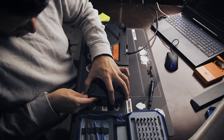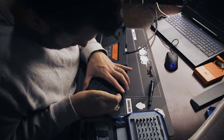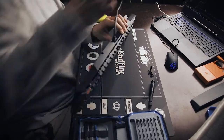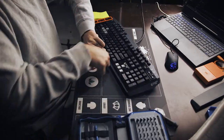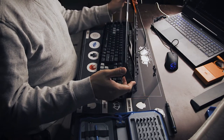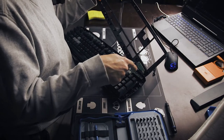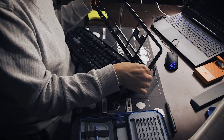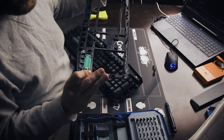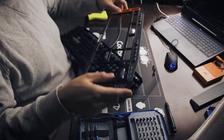Let's go ahead and see if we can pry this guy open. I'll take one of my little clip tools and we'll see what we can do. That seems to be it right there. Now there is one small connection — that is the roller knob to the actual circuit board. So I'm going to very carefully disconnect that. So now we've got our top panel here and you can see what's left is the roller, which we can separate, and a couple of switches there which we should also be able to remove.